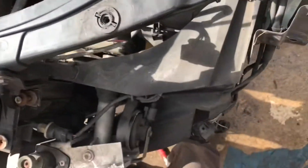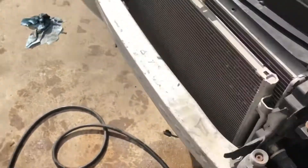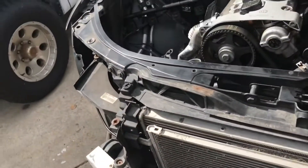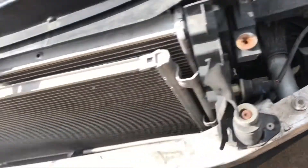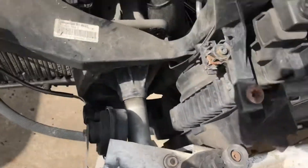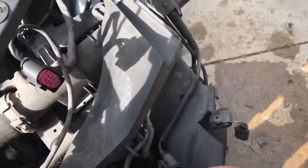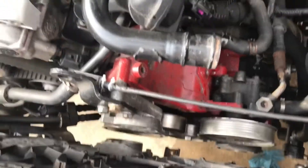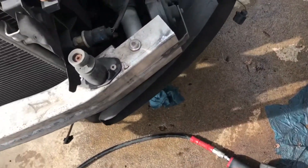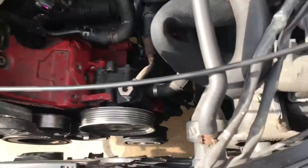It was almost inevitable — I had to get the front bumper into the service position. I dreaded doing it, but it didn't take that long and was actually pretty easy. Once you get the headlights out it's easy to see which bolts need to come out — there's not that many, just a few on each side, one over here tying the fender in, same thing on the other side. It's almost symmetrical, then the ones on top. You really get some extra space between your engine now.